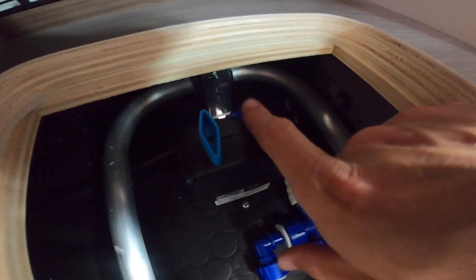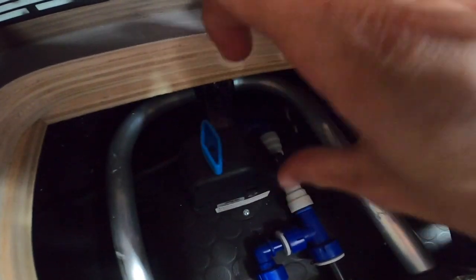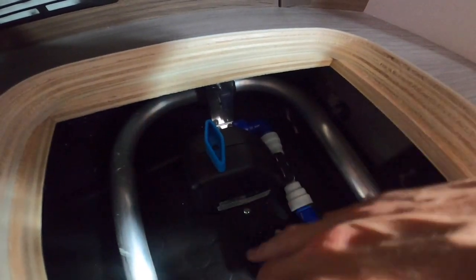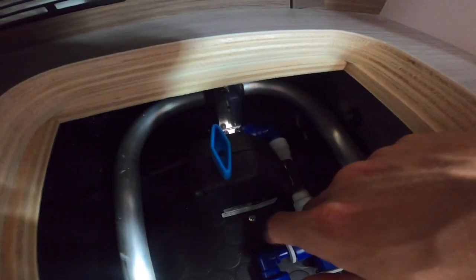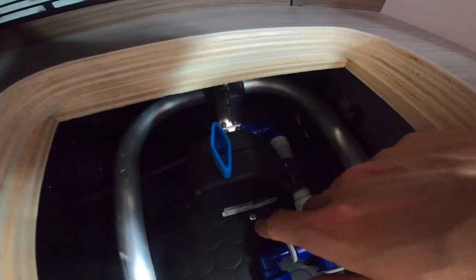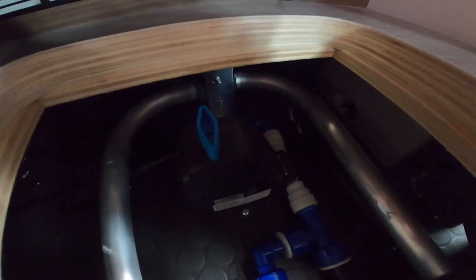But always drain the boiler down by here, by turning it the other way, button pops out, and leave it stood when you're not using it with this open, so no water can freeze, and then you shouldn't have any problems when you come to reuse the vehicle.